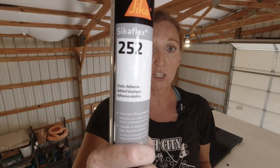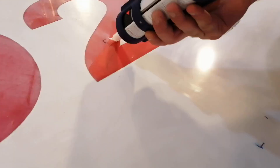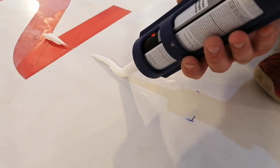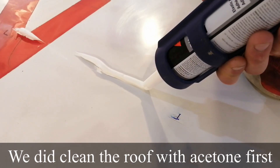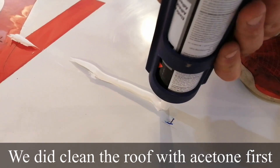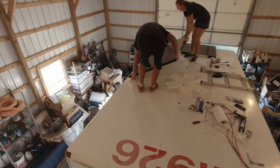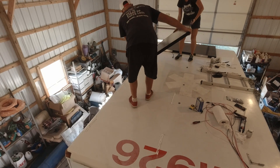We're going to be mounting our panels with SikaFlex 252. We're not going to be putting holes in the roof for the mounting of the panels. SikaFlex is an amazing adhesive, but what you need to know is that once you adhere something with SikaFlex, do not plan on taking it off — you need to be 100% certain you have it in the right spot. Because our roof is aluminum and our brackets are aluminum, we don't need any kind of surface preparation from SikaFlex. If your roof is not aluminum, check the SikaFlex website because there are adhesion promoters and different primers depending on your base material. And now we can finally install the solar panels.